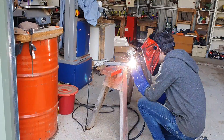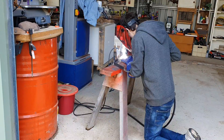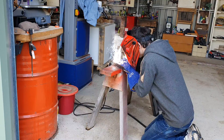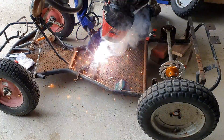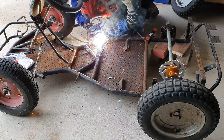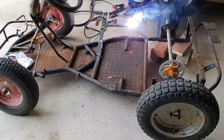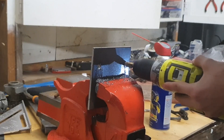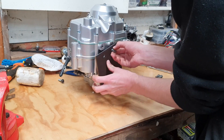I'm not a professional welder, but I highly recommend buying a little bit of extra material in case you mess it up or for tuning in your welder — that's what I did and I got pretty good results. When welding to the frame, make sure it's very strong because a lot of forces will be happening on this extension. For the motor mount, I used a bit of paper to get the dimensions and drill the holes, but they weren't too spot on, so a quick run over with the file fixed it up very quickly.